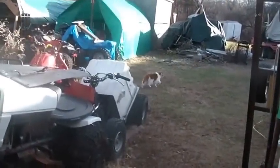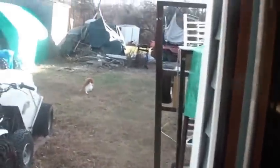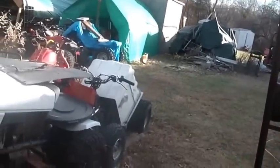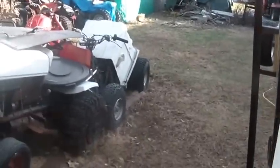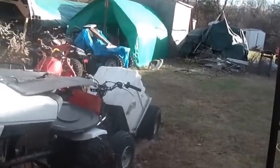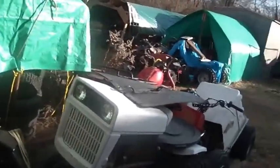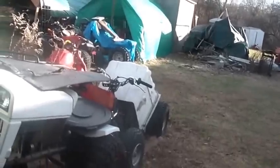Some people say you're crazy, they should be as tight as possible — crowd the spec a little bit and you get more power. They're right, you do get more power that way, but I'm a little more conservative. I just assume not blow these bikes up. I've said it many times on these videos — I happen to love the 200S motor. To me it's got all kinds of great things: it's not so heavy that I can't pick it up or move it around, it's relatively compact, I have a million spare parts for it, and some of the Chinese spare parts fit it — like the China square CDI unit, which is plug and play and you can pick those up for like 10 bucks.